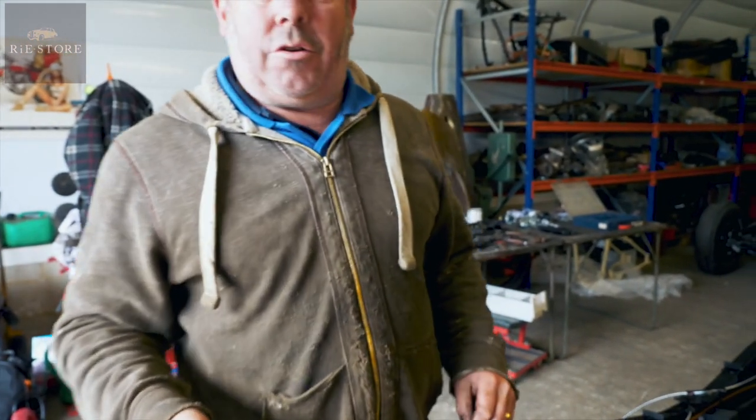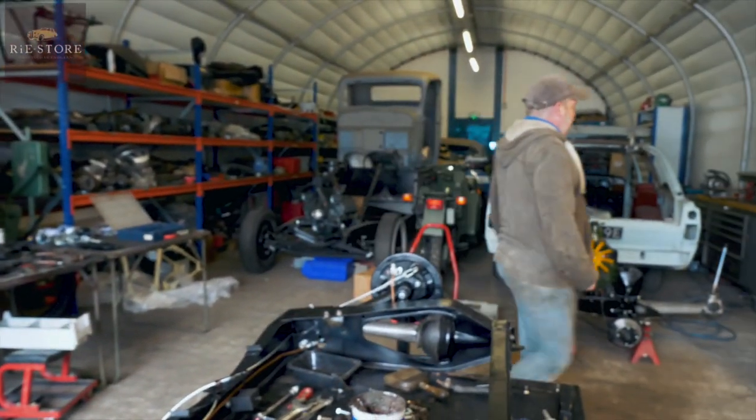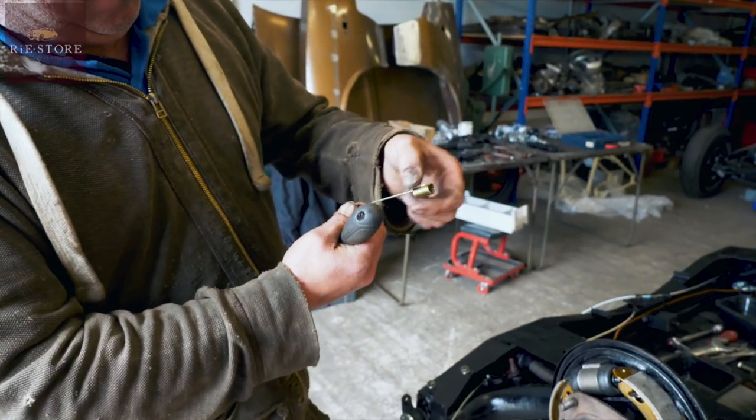Okay. And that would be not good. And repercussions of not having a top spring would be what? Probably just the brakes to just bind up and lock on. Okay. So if you're thinking of cutting corners... Don't go there. Right, so we want to go with that way round, so the spring's at the top.